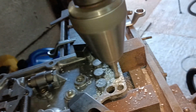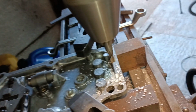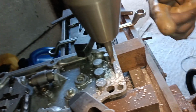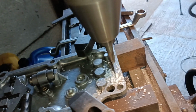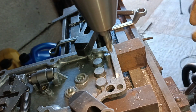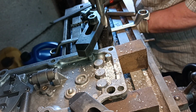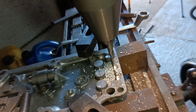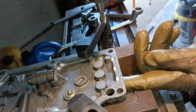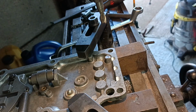I'm going to chicken out and call it good at that. So let's wind the depth stop down to there. Right. I'm chickening out at that. Where's your fingers, mate? Okay, I need to wind the table 905 thou that way. Right, okay, good. I will go and offer this to the car then and hope that it goes on okay.